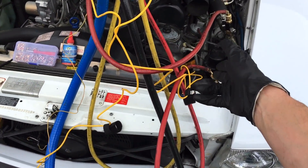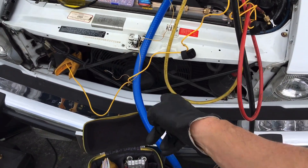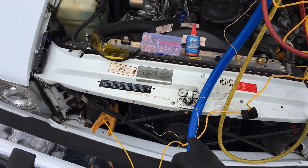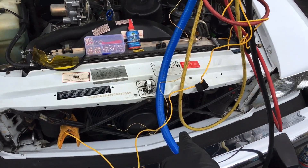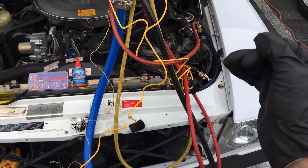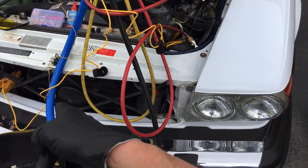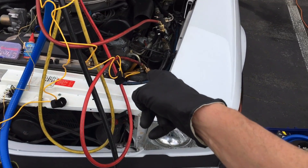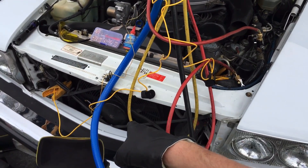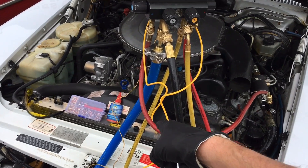So this will get a compressor, this will get a fluid-driven thermal fan clutch, and the shop will find what is wrong with the fan circuit — why it is not engaging electrically. But this customer will get a good working system for now. Other than that fan issue, I told them: do not use the air conditioning without that electric fan working.